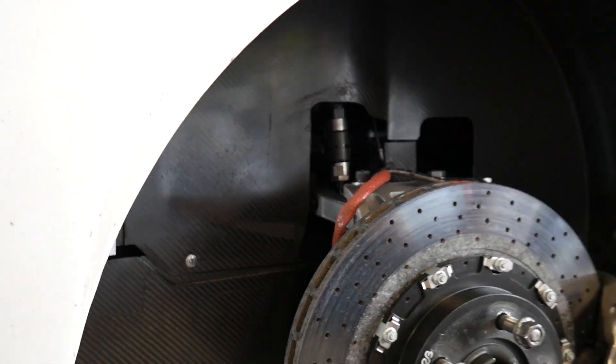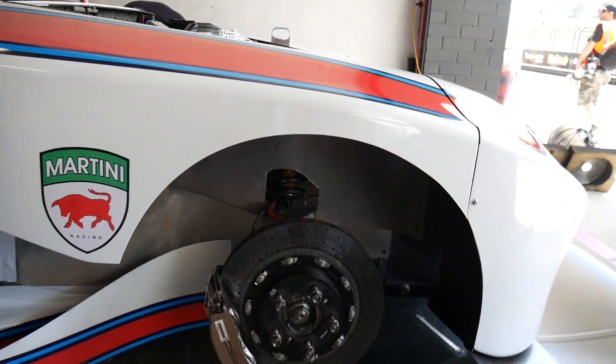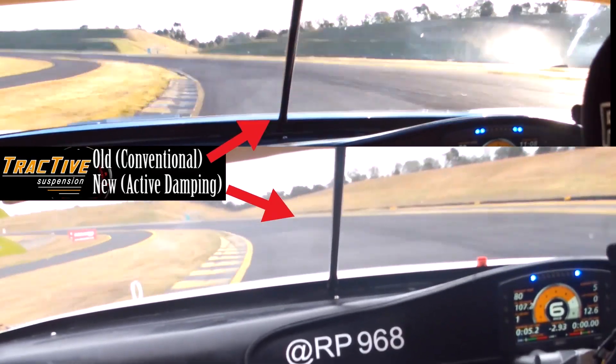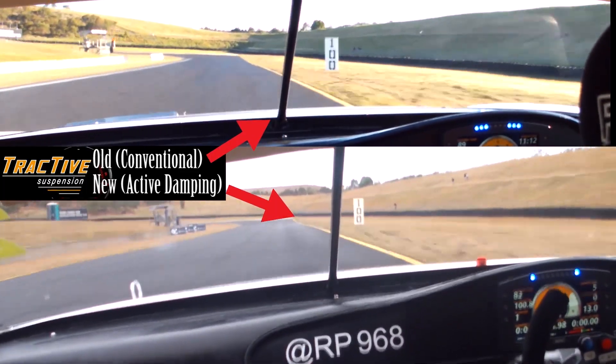Now this tech has been running on the RP968 this weekend — what advantages have you found and what adjustments have you made to the dynamic and static mapping? The biggest advantage we found this year is that we're able to run two hot laps on a set of green tyres — none of our competitors are able to do that. It gives us the opportunity to learn on one lap, get the driver up to speed, and then have another go. The driver can make a damper change himself through a mode adjustment while he's out there. In terms of mapping changes, we've been working on roll control, particularly inside wheel stiffness. Our inside wheel is quite flexible over bumps, so you can maul the kerbs and still have good roll control — and that's where we're making a lot of aero gains by keeping the car flat.